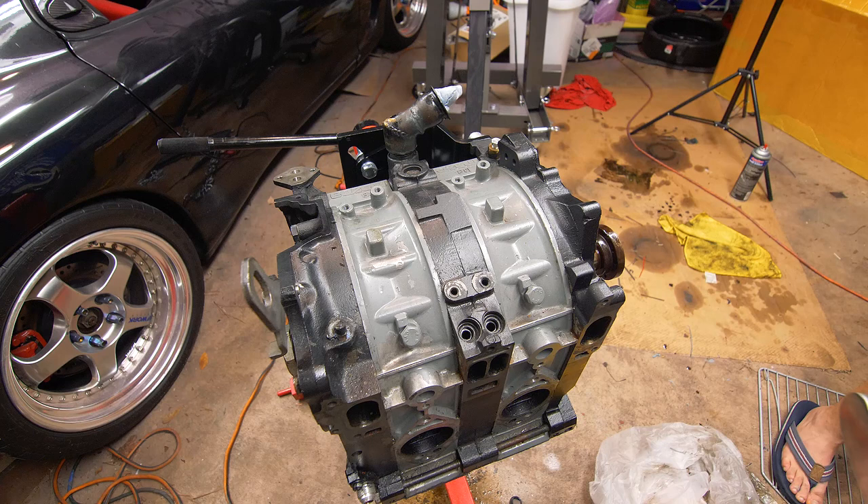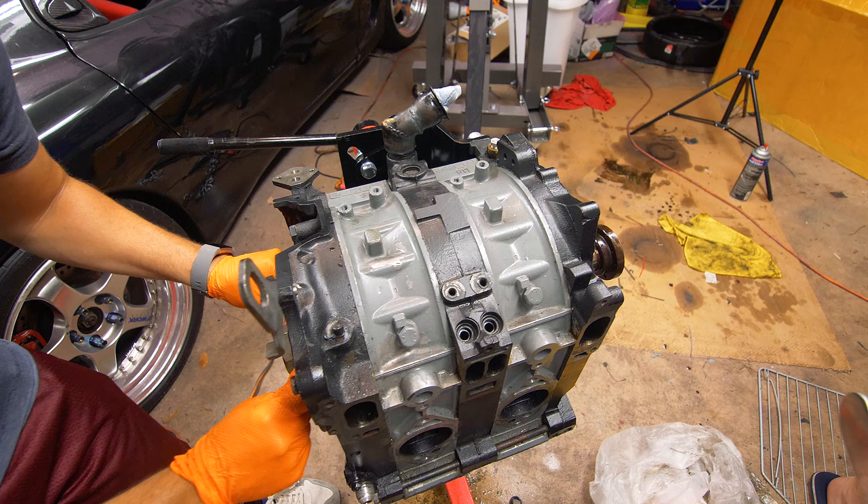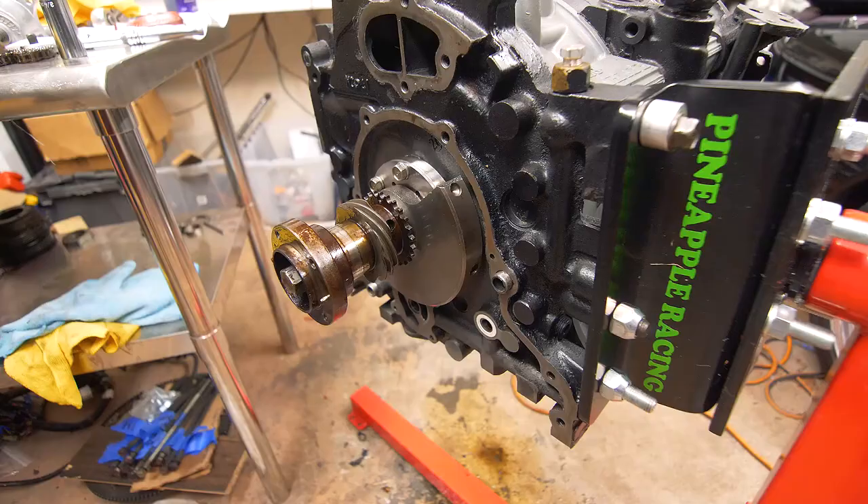With the motor on its side, the first thing you can check is an audible noise — you'll hear a little clinking noise if you basically pull and push from the rear counterweight, and what you're hearing is that end play. So if you hear a clinking, that's good.